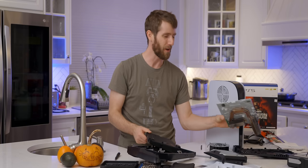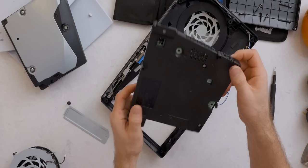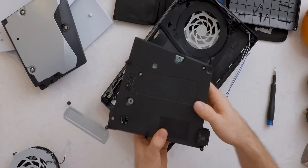Labs has a note in the script about how they were able to get that warranty-void-if-removed sticker off without tripping the indicator — I was wondering why it was still all black. Good job with the heat gun. Now let's talk about the power supply. I'm not going to open this up, but we do have some stuff to say about it. First and foremost, it is rated for exactly the same amount of power as the old one — 12 volts, 31 amps, so 372 watts.